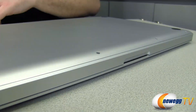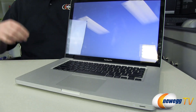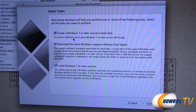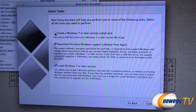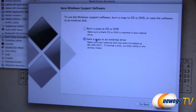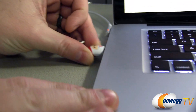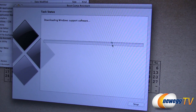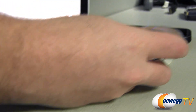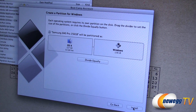Now that our hardware is configured, we can move on to setting up dual boot. Boot up your Mac — it should be booting off of the SSD now. Go to the Go menu, then Utilities, then Boot Camp Assistant. Once you have accessed Boot Camp Assistant, uncheck the first box and check the next two. You'll be prompted to insert either a blank CD or an external drive to save the Apple Boot Camp drivers to. After the Windows support files have been saved, you will next set your desired operating system partitions.